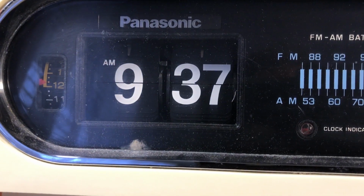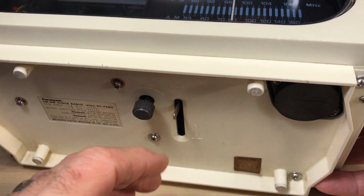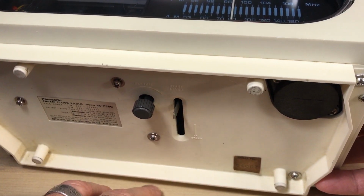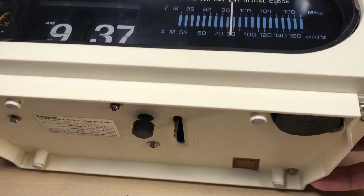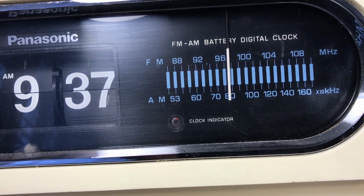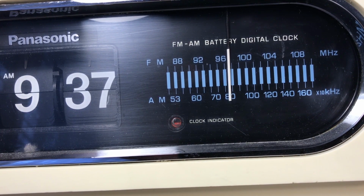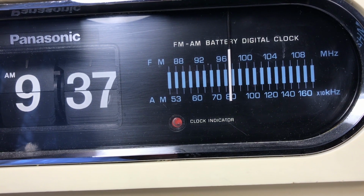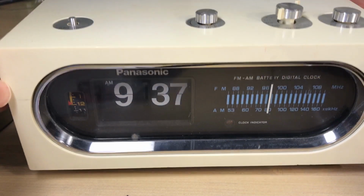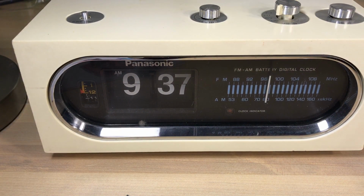But first I want to talk about how this clock actually runs. So I'm going to show you how lightly you push this lever. And it's not the pushing down that starts the clock, it's the releasing it that starts the clock. That's pretty important. You don't have to get aggressive. Now we see the whirligig there moving down, so it's those little stripes there seem to be moving down. That's the proper motion that you're supposed to see when this clock is operating.